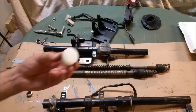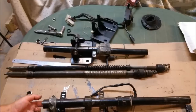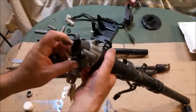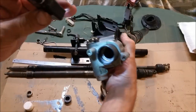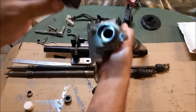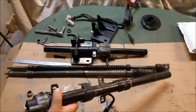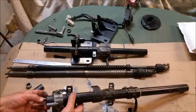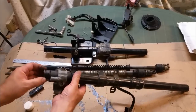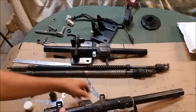This column's not rolled but there's a shoulder in there so it's secured. We can make it the right depth, have it protruding the same as what the bush does, and it will support the shaft. Ford used bushes - I made a steering column bush for the Galaxy where the wheel would move and the indicators wouldn't self-cancel properly, and I machined it very thin. That's all I needed and it worked perfectly for the five years I had the car.